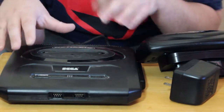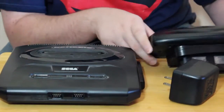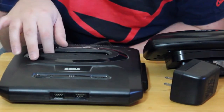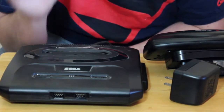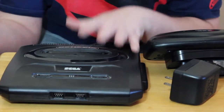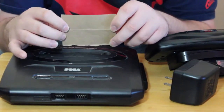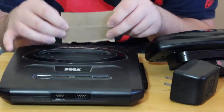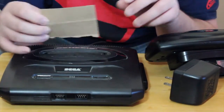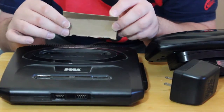Another thing, addressing the rocking. This will rock around a little bit when it's inserted properly. Originally the 32X came with these metal plates that held the cartridge slot open. They're not necessary, but they did aid the rocking a little bit. Something I discovered, if you want to minimize that rocking, take a piece of cardboard, something like cut down a piece of a cereal box, or maybe the back of a writing tablet, just a nice thin piece of cardboard, business card size give or take.